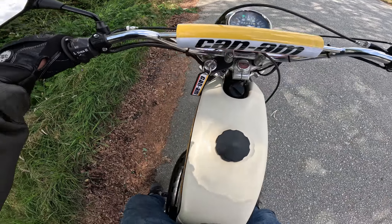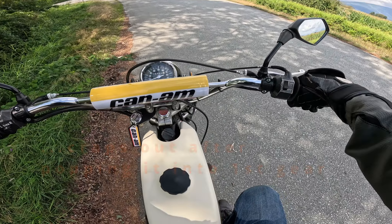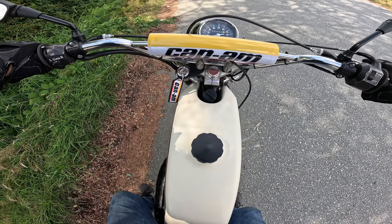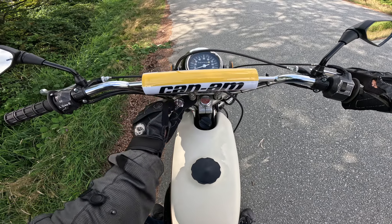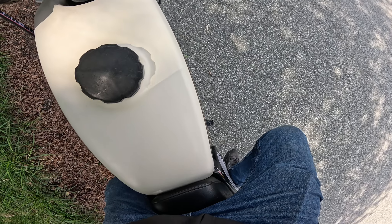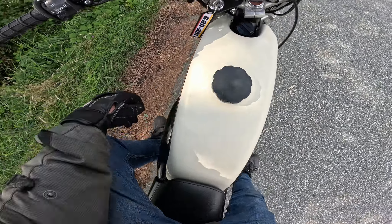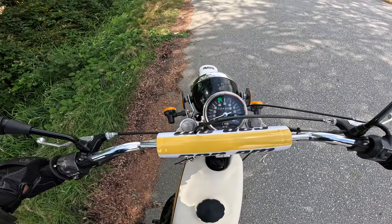What the bloody hell is going on here, guys? I pushed it back to the next street and gave it a few more kicks and got it going again. Was it my own paranoia? It didn't seem to want to start right away — you'd think it would start on the first kick but it didn't. Even when I got back here I had to kick it a few times. I did not use choke at all, purposely knowing it's — I'm about 90% sure that over-fueling is the issue. We're going to continue with the ride and see what happens.